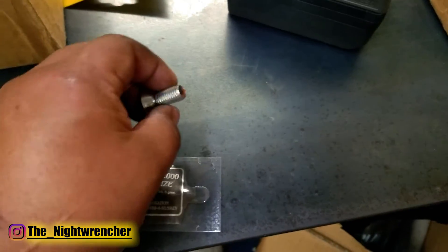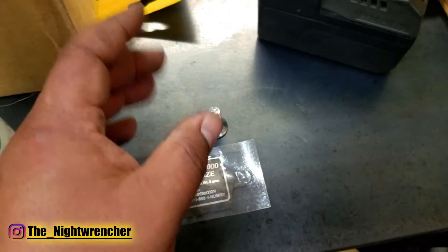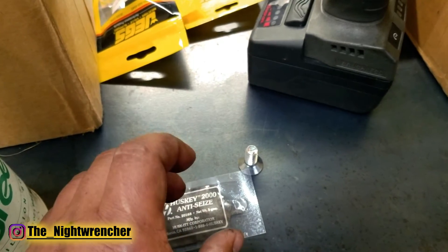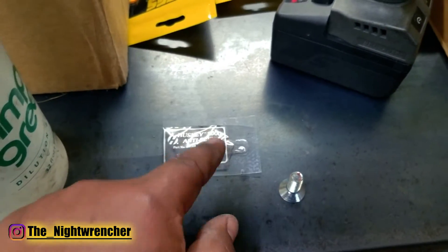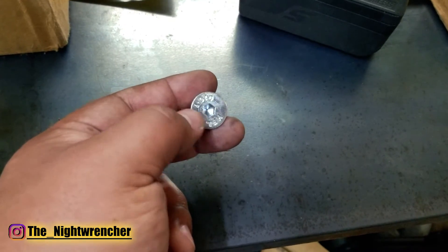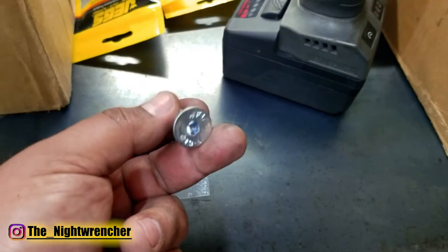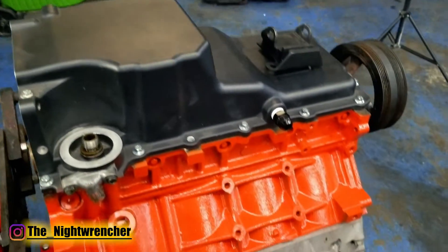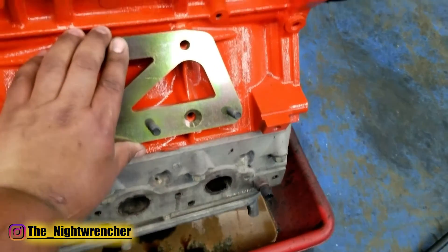They gave us anti-seize in the kit, and the anti-seize is actually for the bolts going into the block. I personally like to use threadlocker because I don't want them vibrating out, but anti-seize works just as well — they do the opposite thing obviously. Anti-seize is so bolts don't get stuck; threadlocker is so bolts don't come back out. The purpose for each is almost the same: you want to fill in all the gaps in the thread so that later on the bolts are not difficult to remove. On these countersunk bolts specifically you really want to use anti-seize and not threadlocker, because these are driven in with a hex head and if later on you want to remove this from the block, the hex could be worn out or damaged by corrosion.